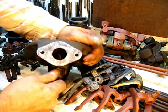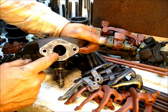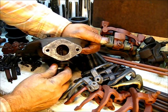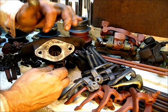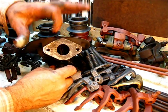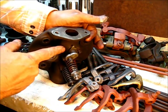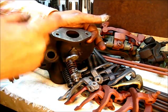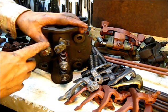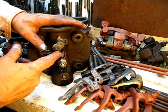This mechanism goes all the way through and there's a flapper — a little baffle — down in there. You'll find these where the head is rusted so bad that when it closes, it doesn't close all the way and air gets around it. You can re-sleeve this to fix that. Also, if the input shaft hole is worn out, you can put a bushing in both ends to bring it back to original — and it needs to be done, because if it sucks air in here you won't have much success with your engine.